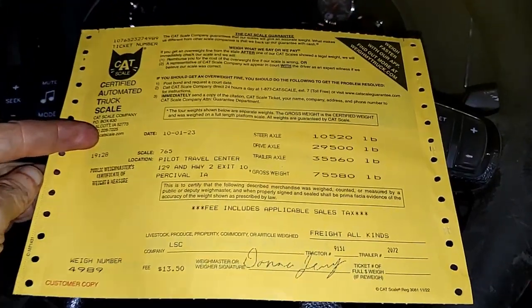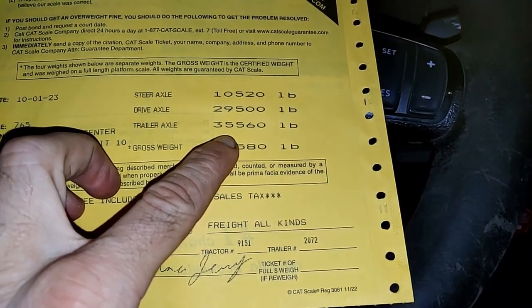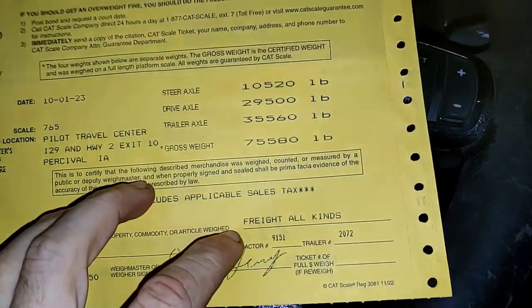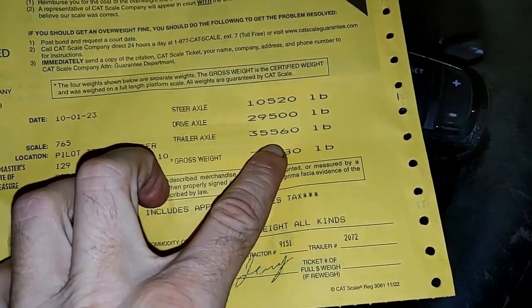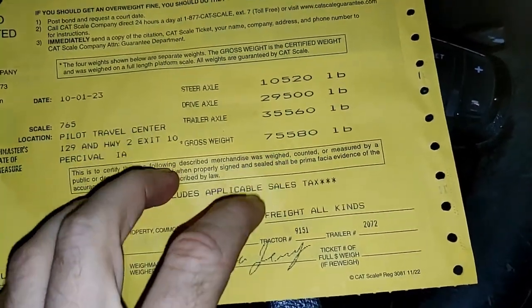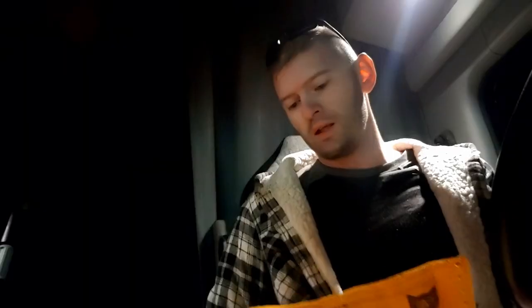What's interesting about this time — actually moving the axle screwed me. It put more weight on the rear of the trailer than on the truck. So this is one of those 10% times where it did not help. But I'm only over just a little bit, so DOT most likely would look the other way. I did slide it four slots when I meant to do three.